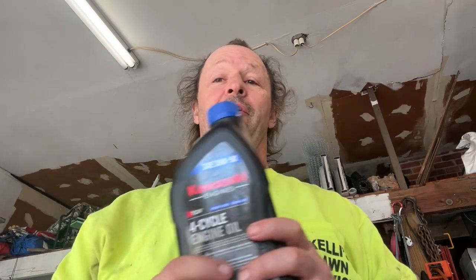Like I said, make sure your filters are on, make sure they're clean, put the covers back on there. You're all done with that. Your vent screws are open and off. So now what we're gonna do, I think it takes about 2 quarts each. We'll find out exactly. You're going to dump in the first quart in each reservoir, and then we'll go to the second until those bleeder or those vent screws, until it starts to pour out of them. Then you know that the hydro part is full. You can go ahead and put those back on. We'll get to that step when we get there, and then level off with the reservoirs on top. So let's take a look.